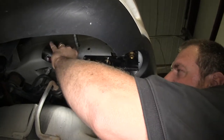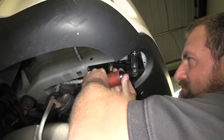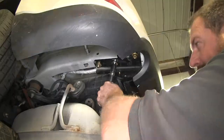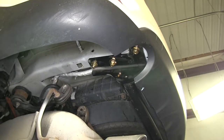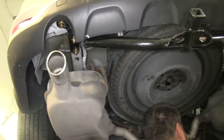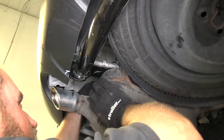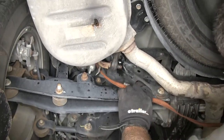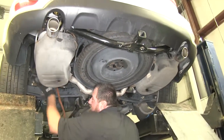Go ahead and run up the bolts and nuts, making sure everything is centered up. Then torque them down to the specifications listed in the instructions, and repeat on the other side. Now that it's all torqued down, slide the exhaust back up and tighten the safety strap, then re-secure it with the grommets. Once all the front ones are on, take the safety strap back down — and that completes the install.